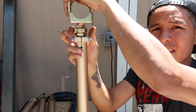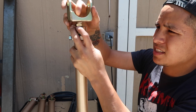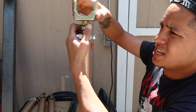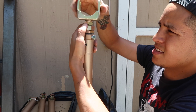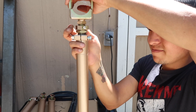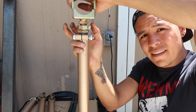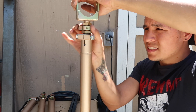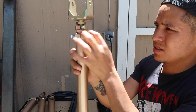You can see it's extending already — it's just the middle one that you're moving, the one that has the lock nut with the Allen. As you turn this it will come out and extend the actual mount side. You can see it coming out, extending. Turn it the other way and it shortens. These two outer nuts are just locking nuts — don't worry about those, just put them all the way back out of the way.